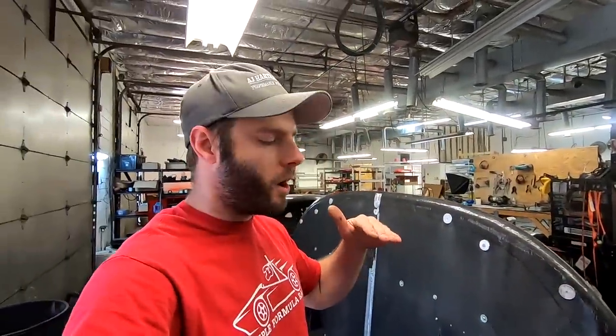I might end up going up a turn on the driver's side of the car, especially because Lime Rock is, I think it's like seven rights and one left. Especially on the downhill, you get a ton of compression under the car. So just fighting to keep the splitter as low as possible without scraping. Let's knock those out.